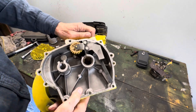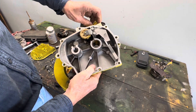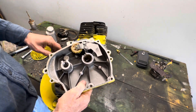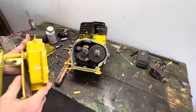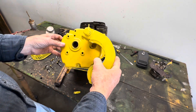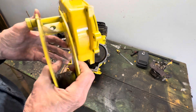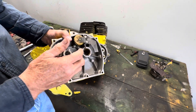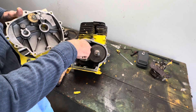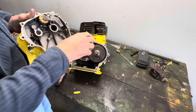This here is your dipstick. I had put that in there because as I was refurbishing it, I put a new O-ring on here as well — we can set that aside. So now we go ahead and assemble like so, making sure that you get your crankshaft over the top. I wanted to mention one thing about this governor: it has got teeth on here and runs off your camshaft — that is what makes your governor run, off the camshaft itself.